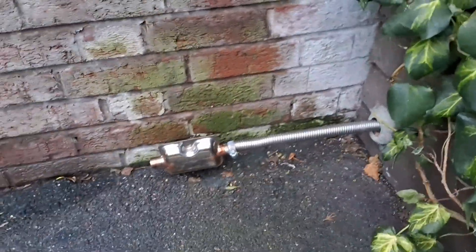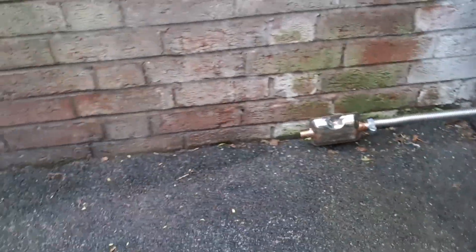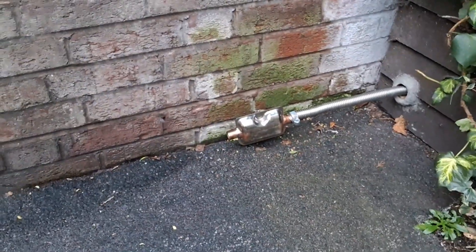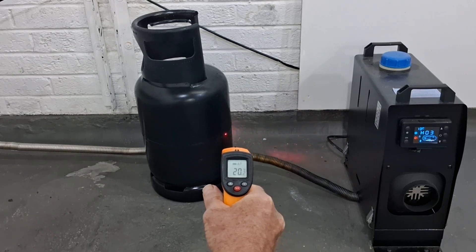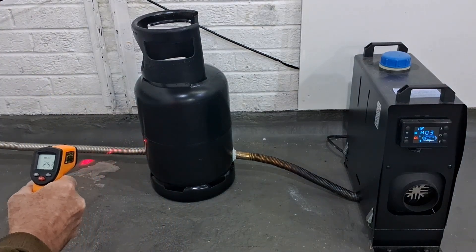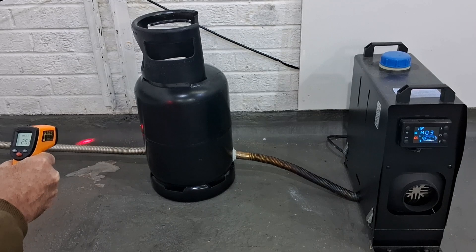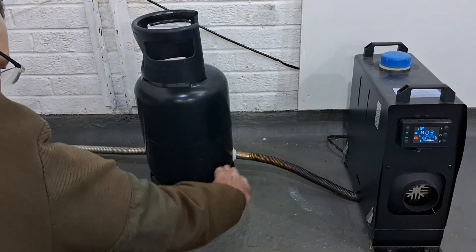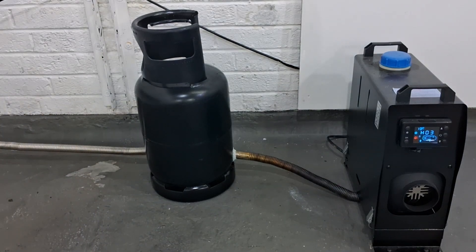Outside with the exhaust, there's quite a bit of condensation coming out now that we're passing the exhaust gases through the bottle. Normally there'd be absolutely no condensation coming out the exhaust by itself. Temperature check around this side: 21-22 degrees. As I said, the exhaust gases go in and slightly upward, and around this side is the hottest part - we've got 26.5 to nearly 27 degrees. The exhaust gases are hitting this side and that's where the hottest temperatures are.